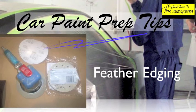we're going to feather edge around there to get that good and smooth, a real smooth transition. You can think of it like layering the paint, feathering the paint, however you want to think about that. But that's the process that we're doing. And to do that, we are going to use a DA sander, a dual action sander, and 220 grit sandpaper.